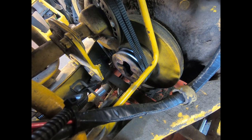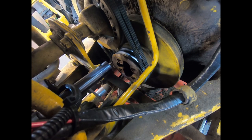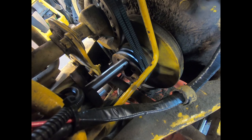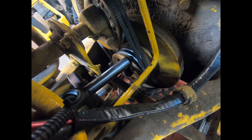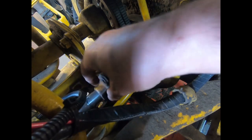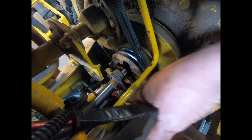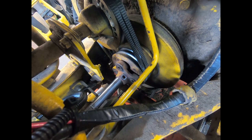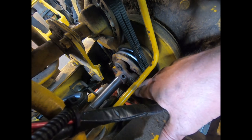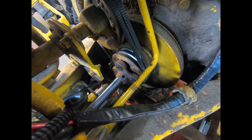When you go to put this main shaft back in, make darn sure that you've got the spider here — the drive — onto this piece, because if you don't, you've got to get it under the electrical wires and you can't get it in later. You've got to have this kind of unbolted. That'll slide right in the middle. Before I do too much here, I'm going to see how the bolts all line up on length. That is just right on the money — got an eighth of an inch clearance on the back.